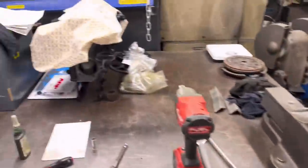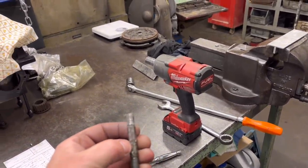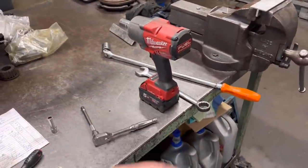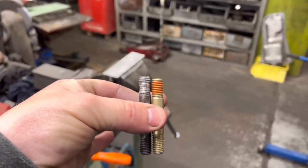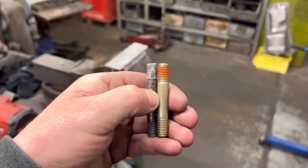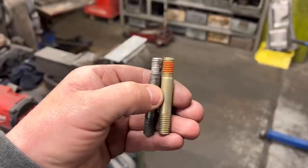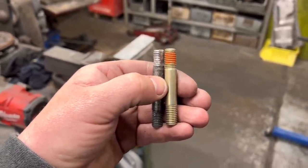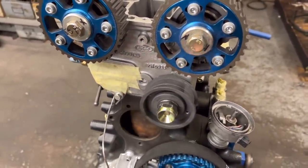It's a bit like modern engines — the Volkswagens are terrible for it. The thread in the end of the cylinder head fails. Not normally on the Cosworths; this is the first time I've seen it for ages, to be honest. But yeah, that is not good. So what we're going to do is stick a Helicoil in the cylinder head and put a new stud in there and try again. Got another stud in stock, but as you can see, that stud that was in it isn't even an original, and it's got that flat on one side — I don't know what's going on there. I don't think it crosses their mind that if this does fail, it's going to cause catastrophe — going to bend all the valves, possibly completely ruin the engine. Right, so we've got that tensioner bolt in now, got it Helicoiled, done a test, torqued that up, and it torques up lovely. So I'm happy with that.